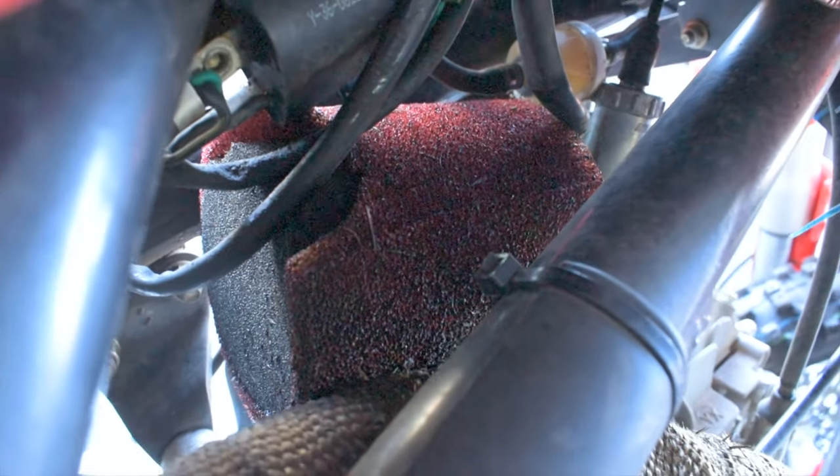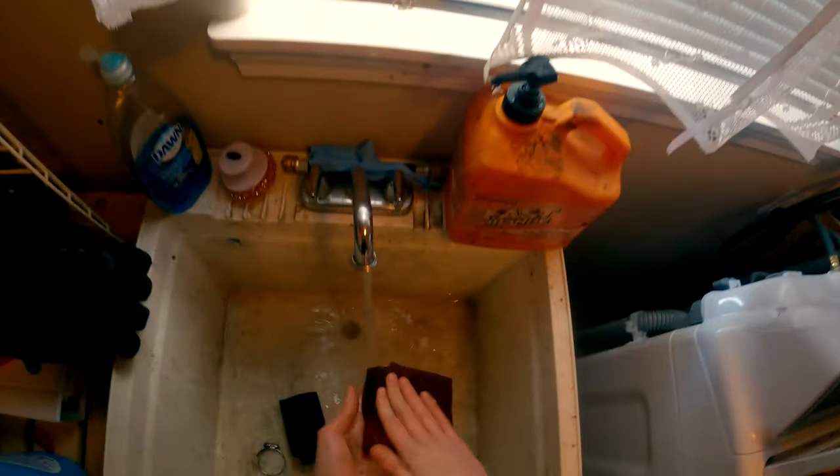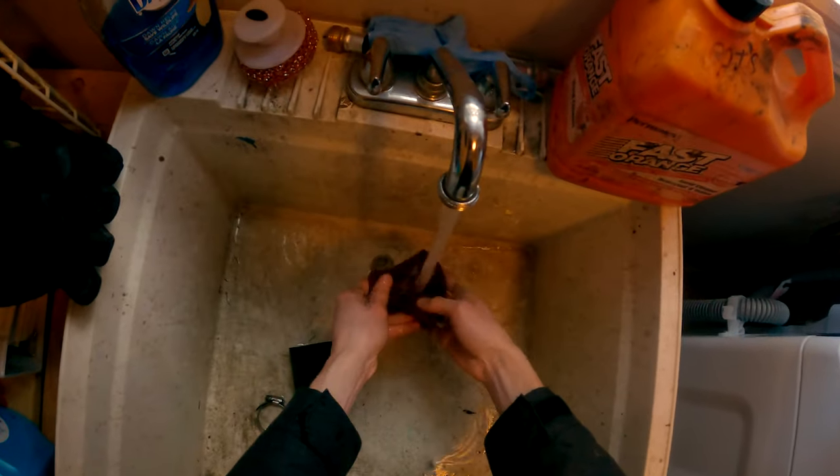The first thing we're going to talk about is air filters. It's important to keep your air filter clean because when it's dirty it gets clogged up, makes your bike run rich, and it's not going to perform well. If you're pulling debris into the filter you could suck that into your carb and possibly into the combustion chamber, causing internal damage. To clean it, remove it, wash it thoroughly with a degreaser-type soap, let it dry, and reapply a coat of air filter oil. All the products we're talking about will be linked in the description below.